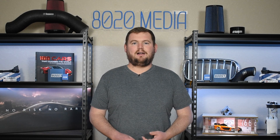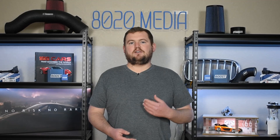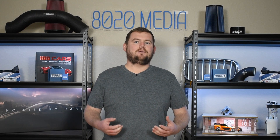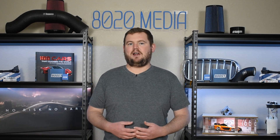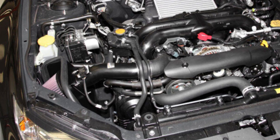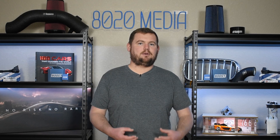Moving on to our fourth and final upgrade for the Subaru EJ255, we have cold air intakes. If you're just sticking with these mods and building a roughly 280 to 300 wheel horsepower EJ255, you really don't need an intake upgrade and it's likely not going to offer any significant power gains. However, the benefit of an intake is that it's a very simple, cheap upgrade and it can add some awesome turbo and induction sounds. If you're looking to save every dime and really just want maximum performance, it's likely not going to offer any significant benefits to make it worthwhile.